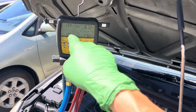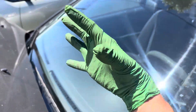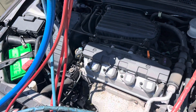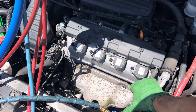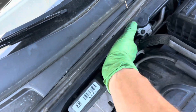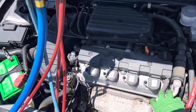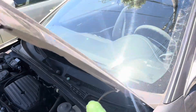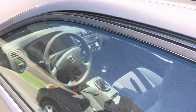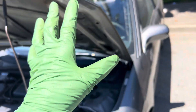It's not going to hit 170. Look how low we are — a little low for this car. That expansion valve is pulling a little low; it's a little on the restriction side. Now I have the filters out, it's wide open, it's hot inside, and it's trying to recycle — and I'm still getting a pretty low high side. It's cold out the dash. I'm getting hot air on my hands right there — I can feel the pulse of heat at my fingertips. The superheat is pretty high and we're suffering from a slightly restricted expansion valve flow of refrigerant. At 79-80 degrees it's doing fine, but on a 90 or 100 degree day it's not going to be happy.